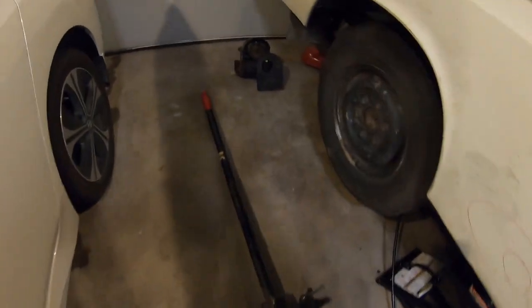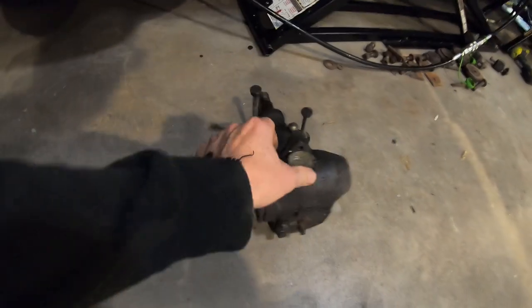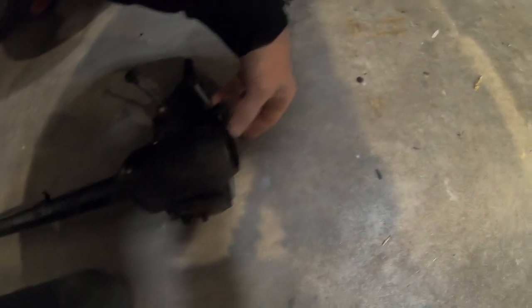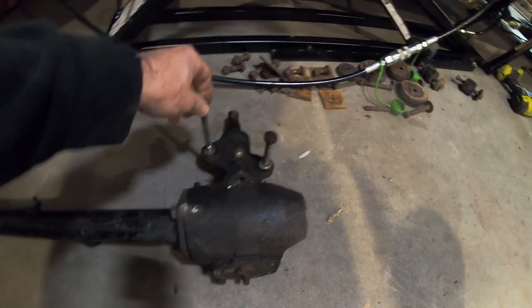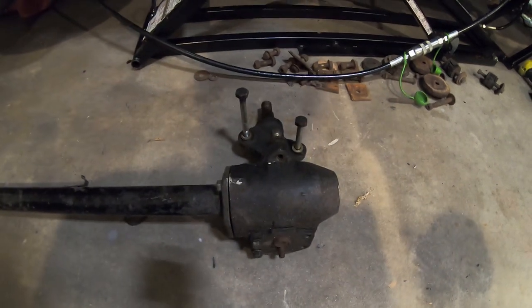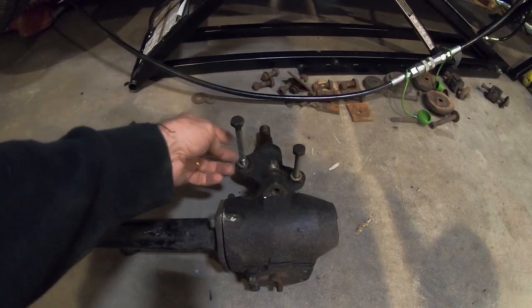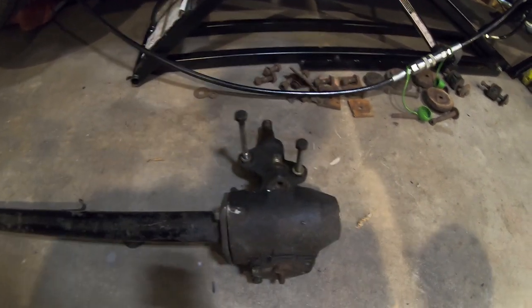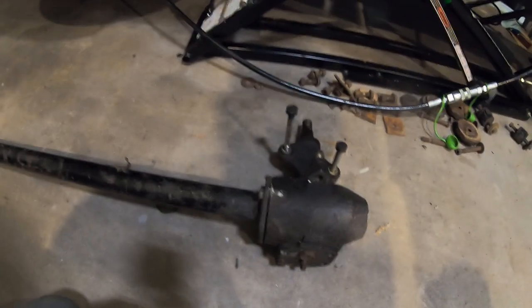So here's the factory steering box that I had, basically my 620, and all these old trucks. It's a steering column and box. This fell out somehow when I was trying to put it back together to get off the trailer. But it's kind of a weird design. It's got a threaded through bolt, and another bolt in the frame. These are all metric, by the way, I found out. They're all 14mm head, 17mm head, and it looks like a 10mm, 12mm bolt. The pitman nut looks like it's 20mm. It's missing. I don't have that. I do have all that end.